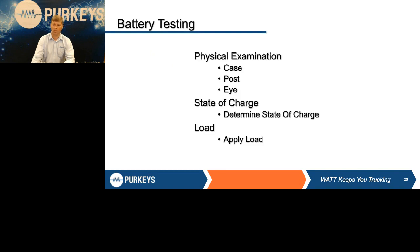Some of us don't want to spend a whole lot of time with these because, again, we've done them before. But take a look at those batteries. If those batteries are damaged, either physically damaged or damaged from not having hold downs, or over tightening. When I say over tightening, that can be the hold down bar, where someone way over tightened and deformed those batteries, or it can be someone using the impact on the battery nuts. Keep in mind, torque on a battery nut is only 10 to 15 foot-pounds.